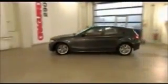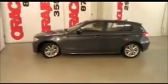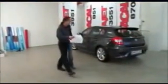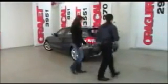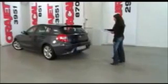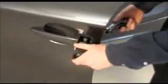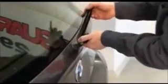The car should be cleaned, then well rinsed to remove all soap and polish residues, and then finally dried. The vehicle should be left with the design contractor the day before application of the vinyls in order for this preparation to be carried out. The vinyls have to be applied in a clean, dust-free and well-lit room at a temperature of 21 to 23 degrees C. Any parts of the vehicle not to be wrapped, such as door handles, trim, rear window wipers, antennas, or wiping water nozzles, must be removed. An appropriate basic toolkit should be available to do this.